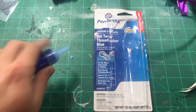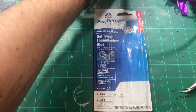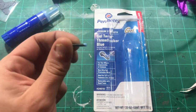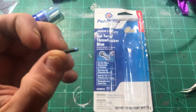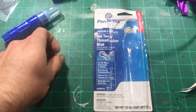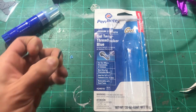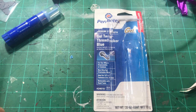If I put a little dab right there on the bench and then put some on this screw right here, I can put it on and it's not coming off anywhere — not running anywhere, just stuck right there. I can rub off as much as I want because I don't need a lot. When I get it into the threads like it is right there, it's going to stay there. When I put it up through my soft mount, it's not going to wipe all over my frame and be useless. The awesome thing about this stuff is it actually dries in those threads really well.